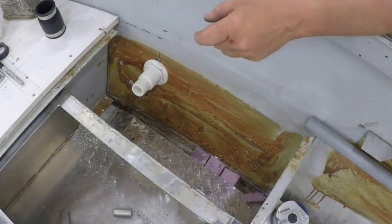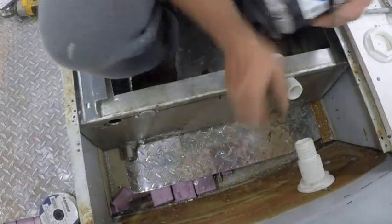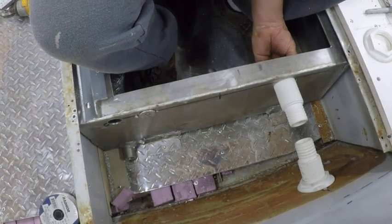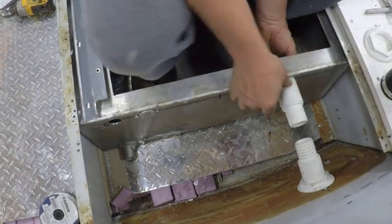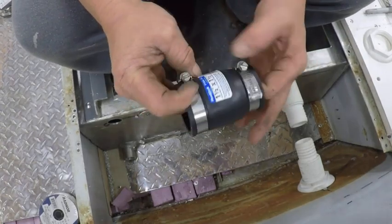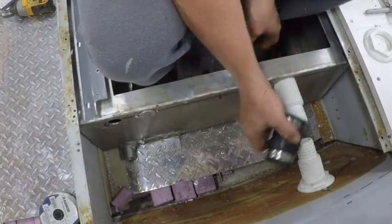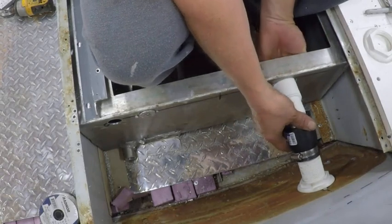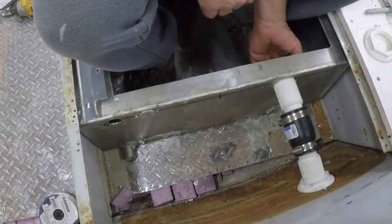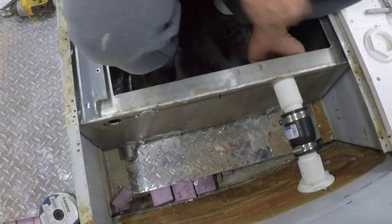Now that we got that one done, it's time to install the through hole coming from this side. When it comes in there, it's going to be really close to that one. So I'm going to use this right here — instead of using a hose, this is made for plumbing purposes. It'll last forever for the most part. It's made out of good quality rubber and it'll slide right over the two of them like this. I'll put it in there — it's got just enough flex that I can pull it up and clamp it down and it'll give a good watertight seal and also a nice little vibration damper. We'll go ahead and get the sealer on this part and get them clamped in.